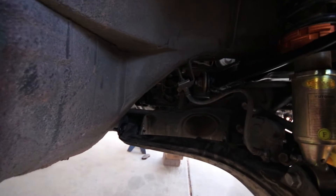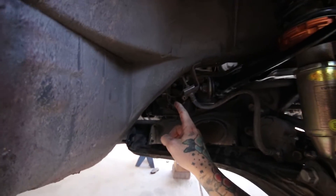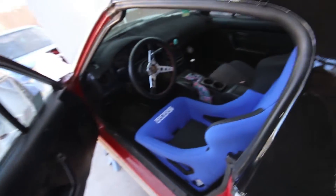I'm going to start by taking the slave cylinder off — come in here on the passenger side wheel well, it's back there. The starter is right above it; those are honestly the hardest parts. The rest is pretty easy. Actually, I lied — I'm going to take the center console first because we have to pull the shifter turret out to drop the transmission.